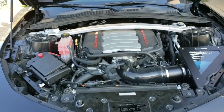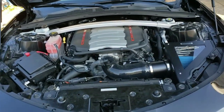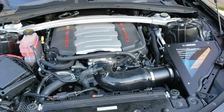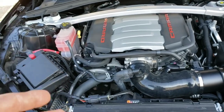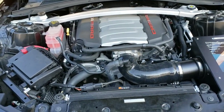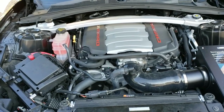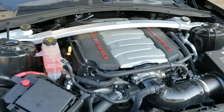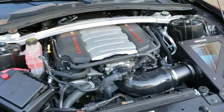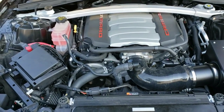Because the fuel bypasses the intake valve, oil that comes down through your intake sits on top of the valves and you don't have gasoline to wash it off. From the heat, it builds up carbon and you get a bunch of buildup around the intake valve. That is actually a problem — you can get decreased performance and decreased fuel mileage, because the more carbon buildup around the valve, the less air that can flow into the motor.